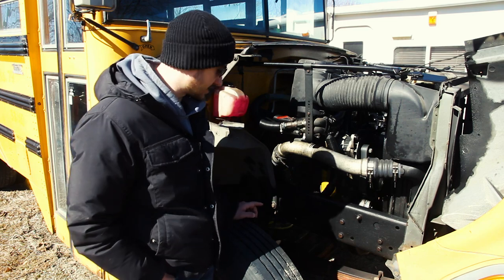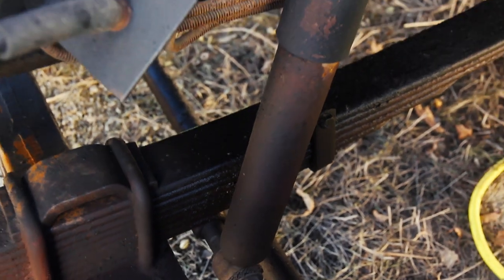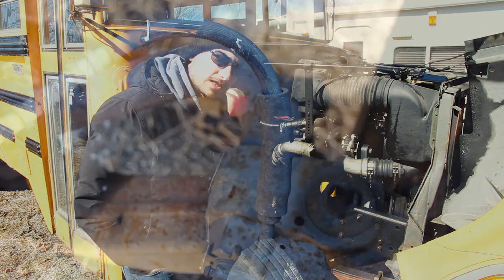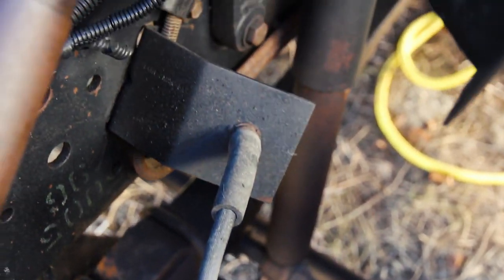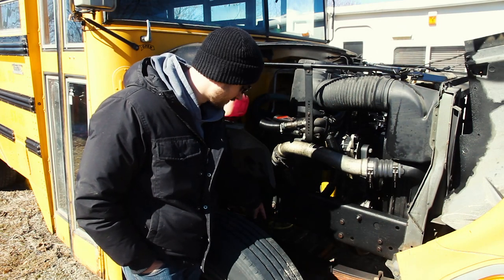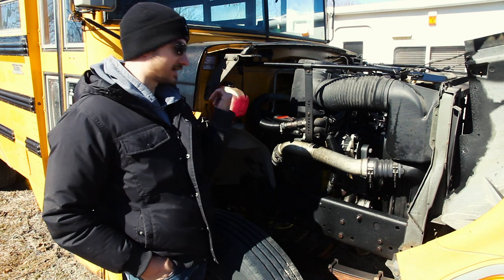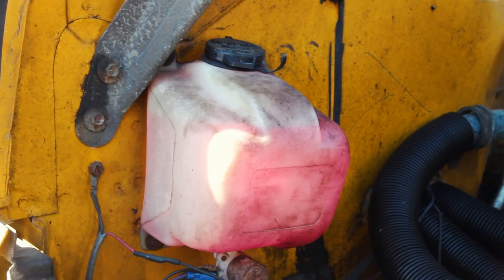Also check your shocks — the main thing to watch for is whether they're leaking oil. On this side there's a hydraulic brake line that comes out and loops back through; some are hard to see but give a quick look to make sure all fittings are properly connected. It typically transitions from a hard line to a flex line for the front wheel as it moves. The only fluid to check on this passenger side of the bus is your windshield wiper fluid.